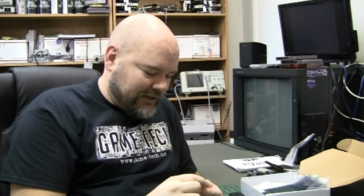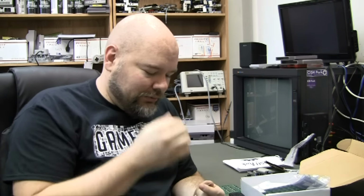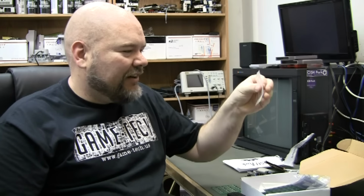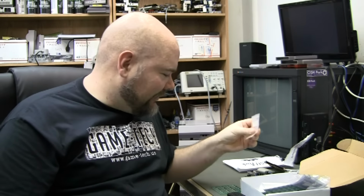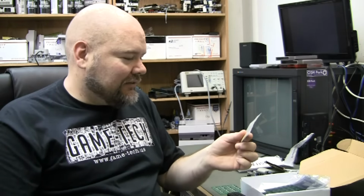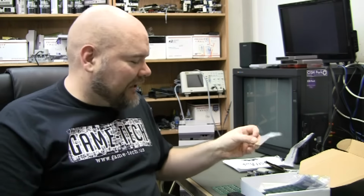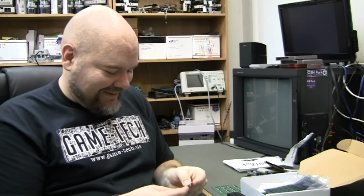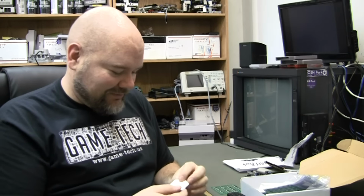Get you a close up of that here in a second, but I had to go back and rework all the holes because my pogo pins are a very, very thin body but a very broad head. That's what I wanted for the TG16, because I was actually putting these pins right into the motherboard of the TG16, and I had borrowed some pins from Ketris, and they were too thick at the body, so drilling the holes out of the motherboard just ruined the trace and it just killed it. So it looks like I got a new OSH Park sticker too. Perfect purple PCBs. No doubt.